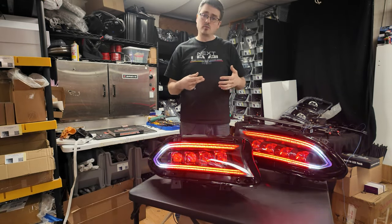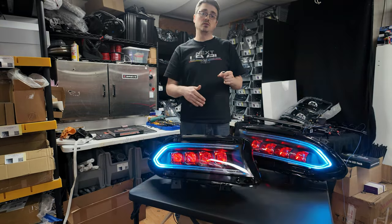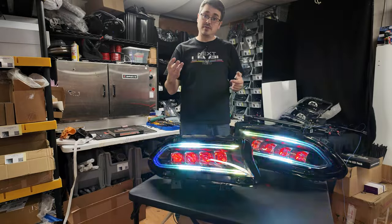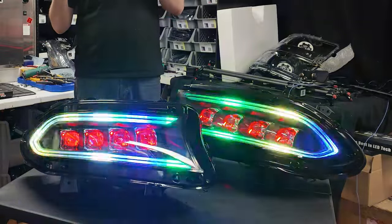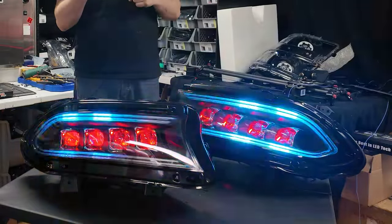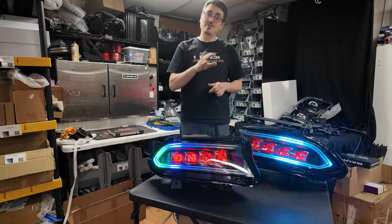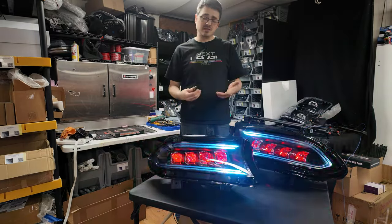So everything is a little bit more automated that way, and that's by using the Plus and the switches and just wiring in that switch into any one of the four switches on the Plus for power, wiring that into any one of the three inputs on the power saver, battery saver, and that will become your automated trigger. And then you just go into the voltage tab in the Ghost app and set whichever one of those four switches you wired into the power saver as triggered. So hopefully that wasn't too confusing. If you need to rewind, watch it a couple times, it should make sense. But it's not very difficult once you understand what it is. It's a pretty simple process.